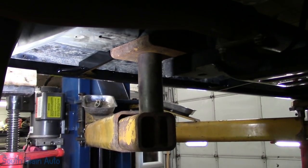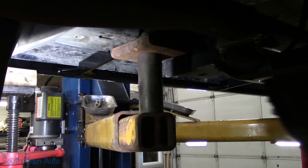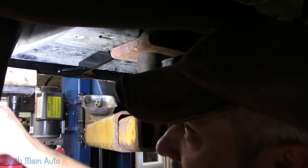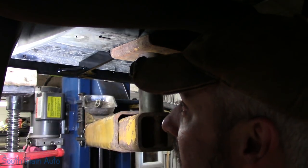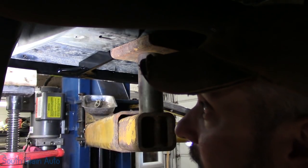Before I do that, one thing I wanna do, this is where I got in trouble on the other side. We just had the back one in. I'm gonna put one of the front ones in. Now this other front one here is kinda tricky because it starts pushing up the corner of the fender. I have to elongate the fender hole because it does kinda crunch the fender a little bit. It's just the way the fender's formed and the way these fit.